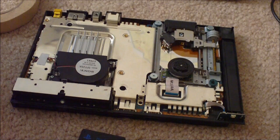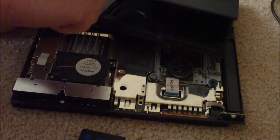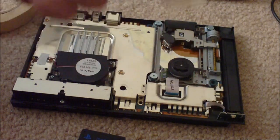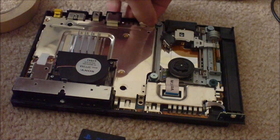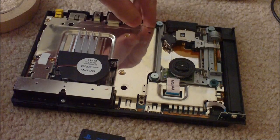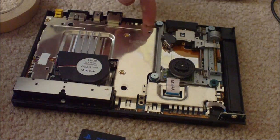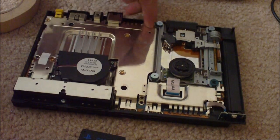For the next step, I'm going to use masking tape. You can use whatever kind of tape you'd like, just as long as it's strong enough and it's not double-sided. If it's double-sided, when you open the slim door it'll pull the sensor up with it. So I'm going to use just a small piece of masking tape and hit that sensor right here, right next to this screw. Just push that sensor down. Keep it right on there. There we go. Make sure it's nice and in there, and it is.